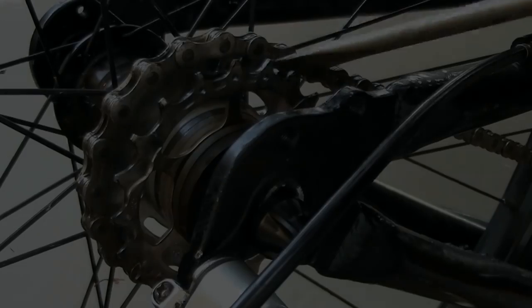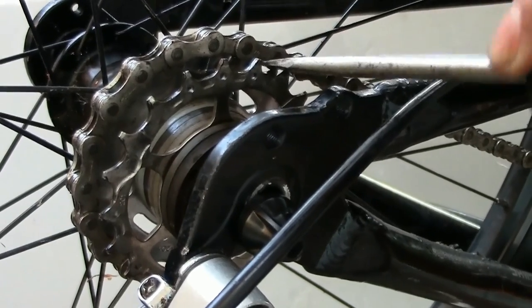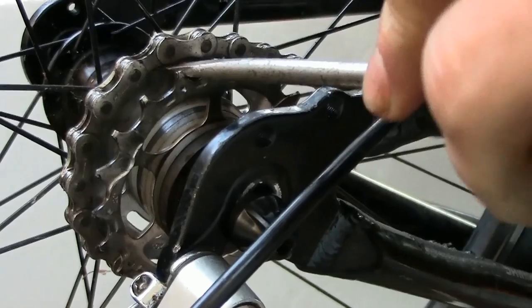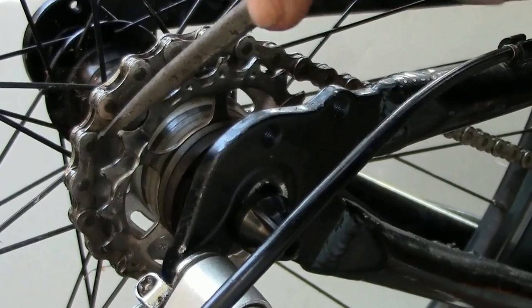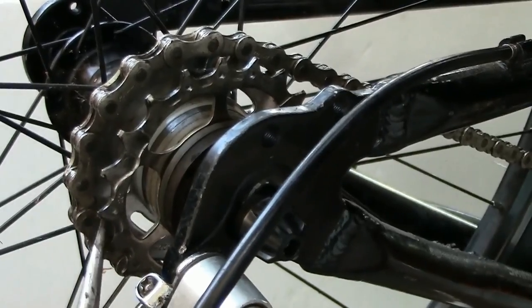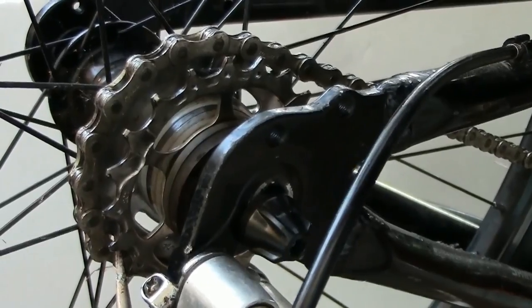Prying up the chain with a screwdriver will give us some answers. As the screwdriver moves back from the top of the sprocket, it is pulling rollers at the top downward as well as backward. Then, as the screwdriver approaches the bottom, it is pulling rollers below it forward. The effect on the rollers at the top decreases.